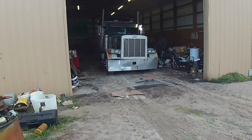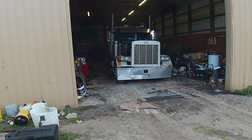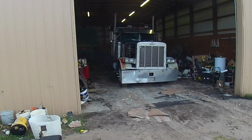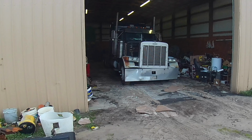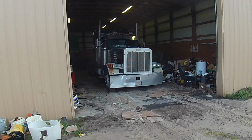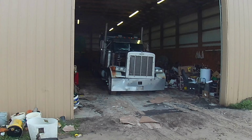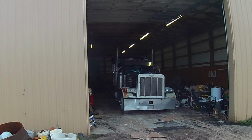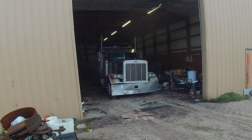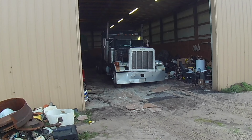See how I got that slight lean to the right side, which was our left? Yeah, the leaf spring is straight up there, so we got new leaf springs. We're gonna swap them out, get the cab sitting back right. I'm gonna take the block out the front and lower the front end down a little bit, put a new bumper on it and redo all the lights, take the horns off the top, add cab lights. Get it looking right. You're gonna put a new bracket on that mirror on the driver's side, straighten that bar out, get that mirror kind of straightened out. Other than that, we'll see. The fairings weren't too bad.